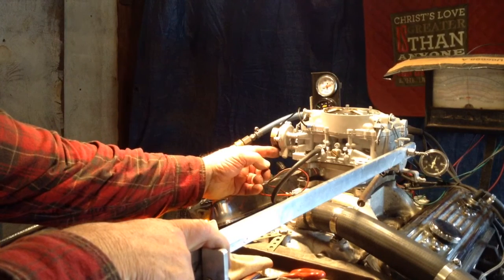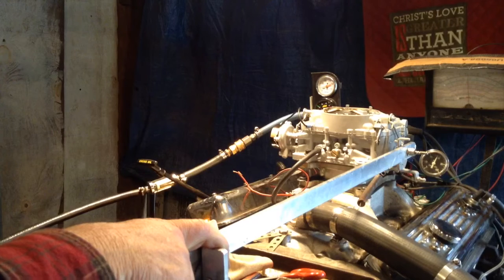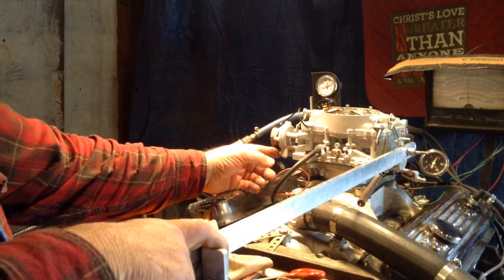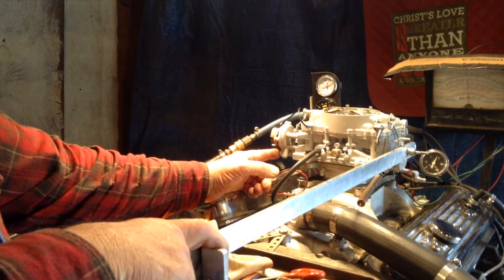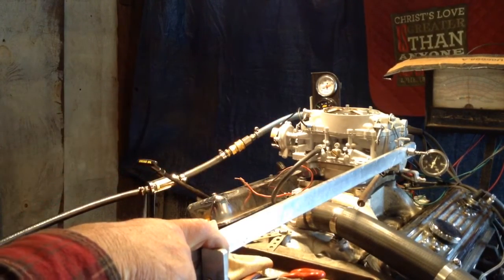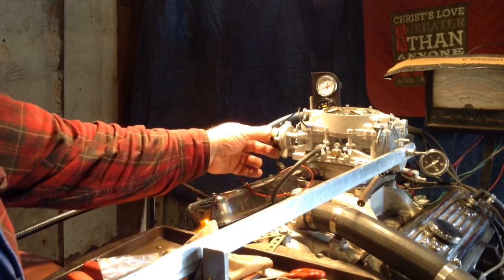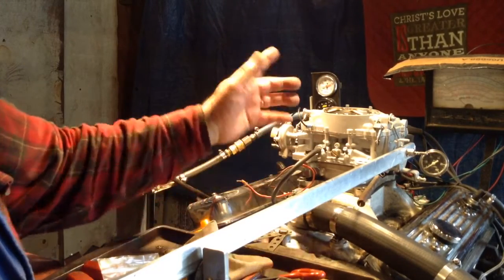I don't know why they want to leave that open, but we don't ever leave them open. I don't think that's an original electric unit because it was chrome-plated, and I don't think those were chrome-plated original ones. So I'm going to leave this open. You might want to think about plugging it with a soft aluminum plug if it hinders the speed of the choke opening. The only thing it might do is let cool air in there, and you need all the hot air you can get to make that choke open — to release it so that it won't burn up a lot of gas. With this thing sucking cold air from the outside, it's going to have a tendency to cool that spring off in there, so it's going to stay choking longer. I would say plug that up and the choke will turn off quicker and save fuel.